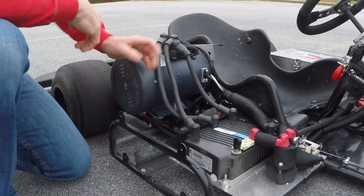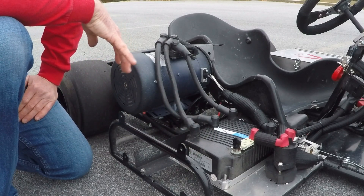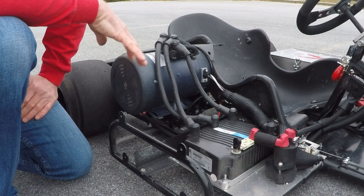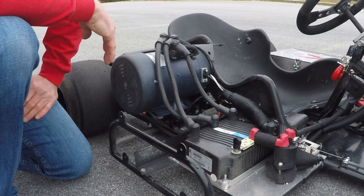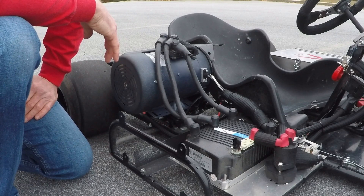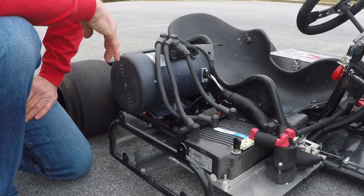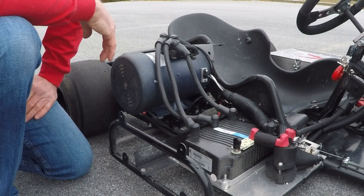The second component is the motor controller. The purpose of a motor controller is to essentially act as the brains of the electric cart. It is what tells the battery pack how much power or current to pull from the batteries and put into the electric motor when the driver presses the accelerator pedal. We are actually using a Curtis controller, model 1236SE — a very high quality product and we're very pleased with the performance so far.